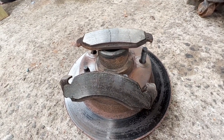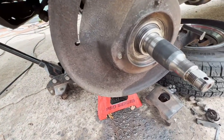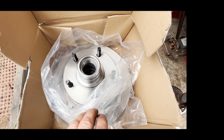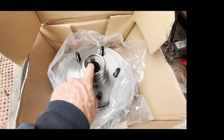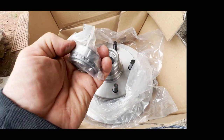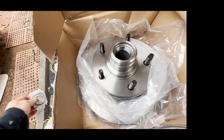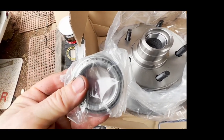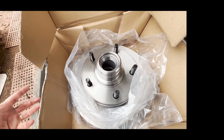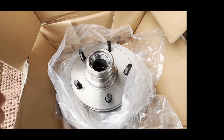We're going to knock out whatever races came in the new rotors and replace them with the new races that came with the new bearing sets. Here's a new rotor that comes with a race installed, but you're not going to use that. You are going to knock out both races and replace them with the races that come with your new bearing sets — generally referred to as cups and cones. Here's the inner bearing; I'll attempt to show you how to knock those out.